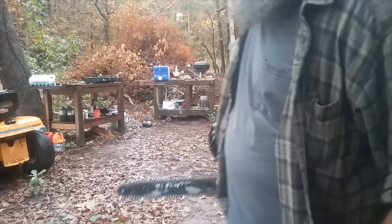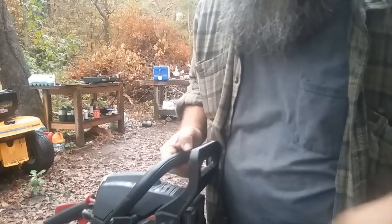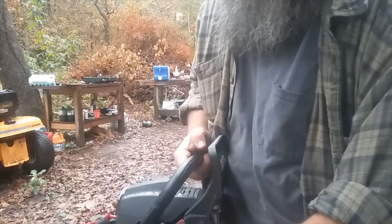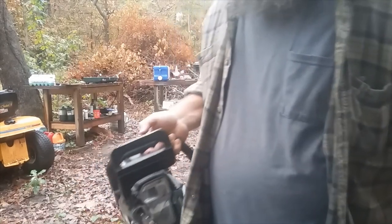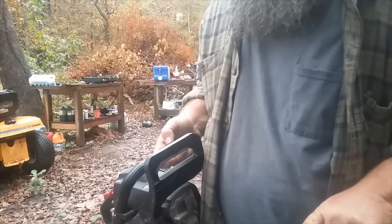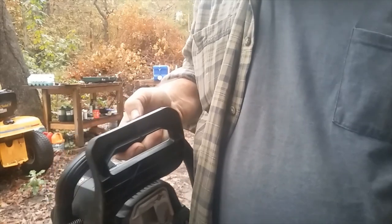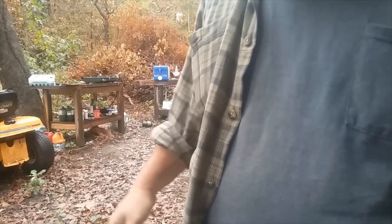Still got a little snap to it — perfect. That is how you replace a chain on a Black Max chainsaw, or really any other chainsaw. The adjustment for the chain is sometimes on the side like this and sometimes right here in front. Jeffrey, I hope that helps. I can't stress enough — make sure your chain is pointed with the cutters facing forward. I know, common sense, right — but anybody who's cut wood long enough has put a chain on backwards at least once. Like and subscribe, share this video on your Facebook, Twitter, Instagram — I appreciate it. Talk to you later.